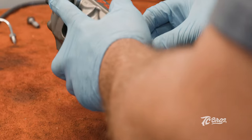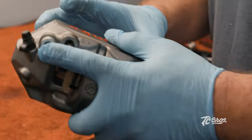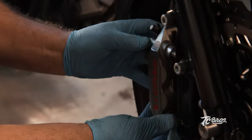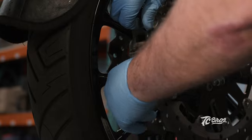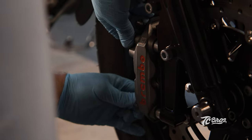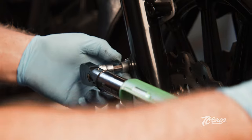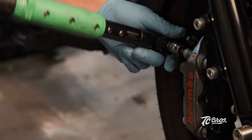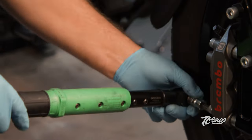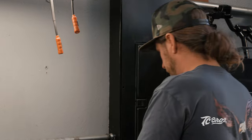We're going to go ahead and get this right side caliper on. We already got our Loctite installed on the bolts, got our spacers on there — everything that comes with the kit. Get everything on here finger tight. We're going to go ahead and get our brackets torqued down to 30 foot pounds, follow up with our caliper and get those torqued down to 30 foot pounds as well. Then we'll come back around to the front, double check our brake alignment, make sure nothing's binding up. Then we're going to move on to the left and repeat the same procedure.